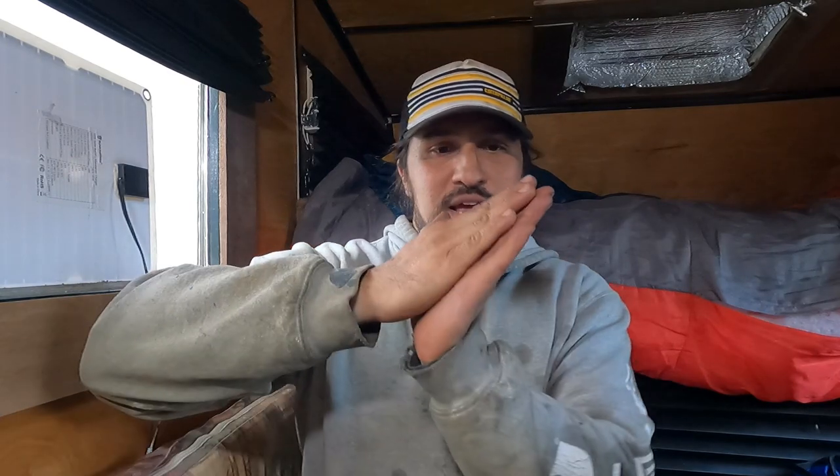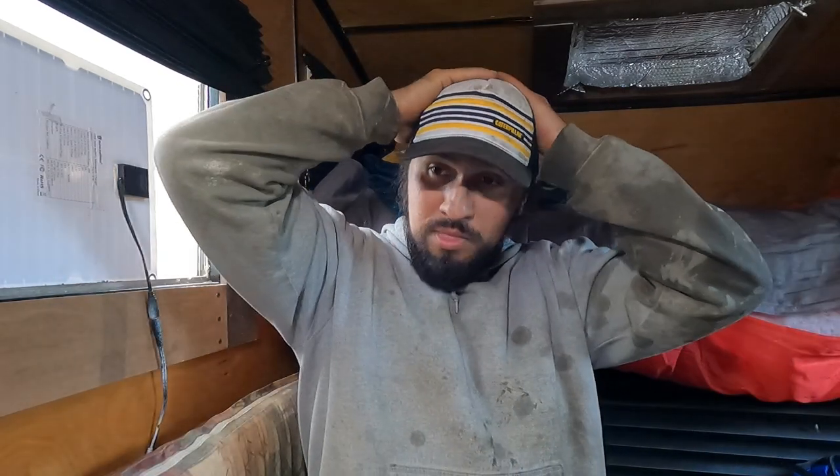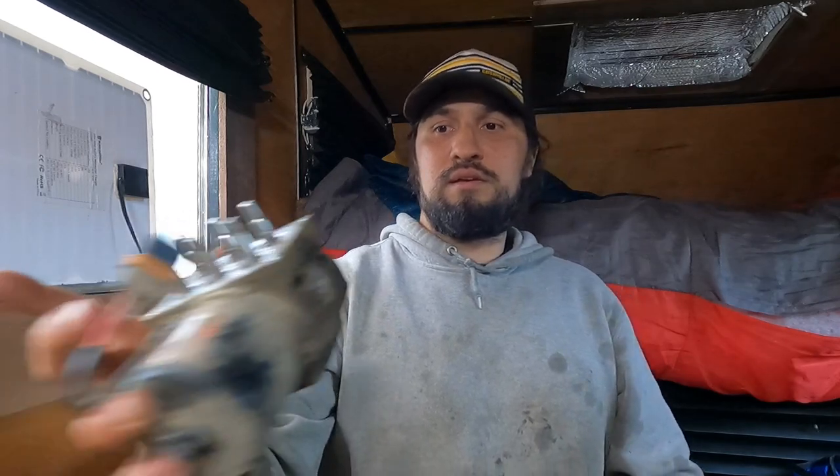The one system I haven't really addressed is the ABS system. I did work on the ABS a little bit because the wheel sensor was funky — when I got to 8 to 11 miles per hour the pedal would drop all the way and the ABS would kick on. I pulled it out and found rust built up between the sensor and the hub, lifting the sensor and causing a false reading. I cleaned it up, mounted it back, and haven't had a problem since. However, my ABS light has been flashing on and off, and now it's just on, and my brakes feel extraordinarily soft for having a pretty much brand new brake system.